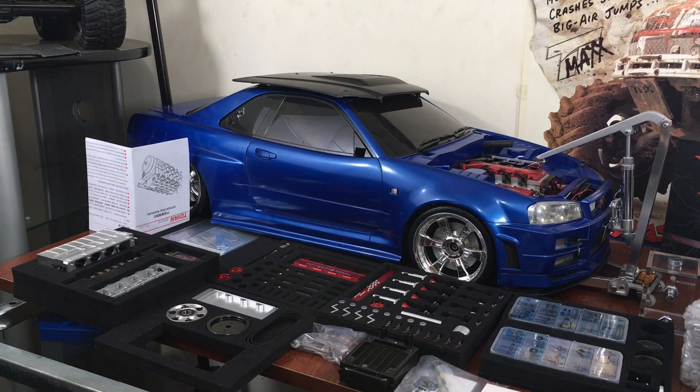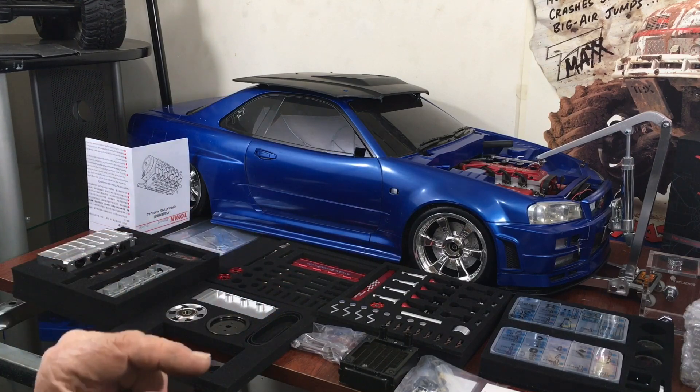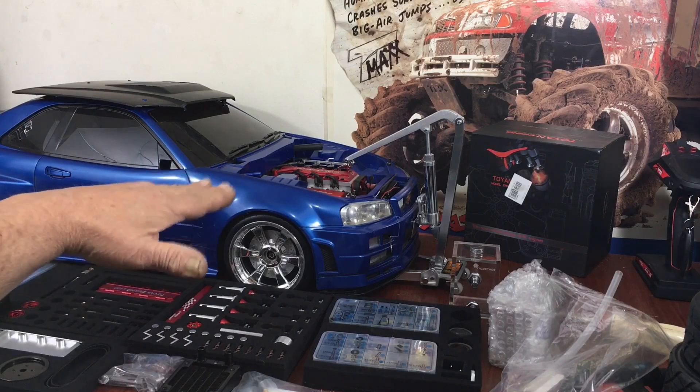Use a light coat of break-in oil on everything — it helps get over the wear-in period. When you first run these engines they get wickedly hot because of all the internal friction until everything seats. That's also why on a nitro engine you run it rich — to keep the heat down, because more heat means more swelling and swelling is bad in a small engine with hundredths-of-millimeter clearances. Start it up, let it run for a minute, shut it down, start again — run for a minute — and work up to longer run times through your first tank of fuel.